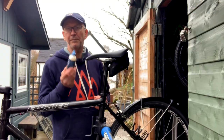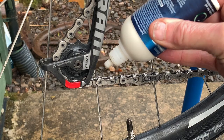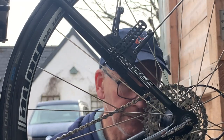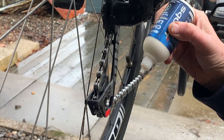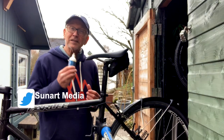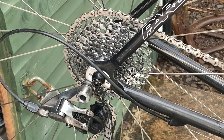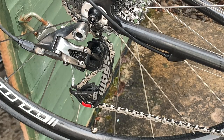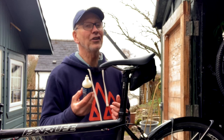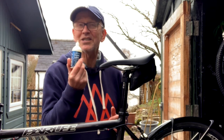The lube is wax in a water-based emulsion. Once you have stripped the chain of any lube, you can apply this stuff — it's meant to be cleaner and extend your chain life. When applying it, I find it's easy to waste quite a lot. It is thin and it drips, and I have gone through loads. This is the cold weather version, so it's perhaps thinner than the regular one, but it's only a few degrees above freezing right now, and I went through the regular one just as fast. In fact, it's probably too thin for the wet winter conditions we get. Many times I would get home from a long ride with nothing left on the chain, which is great that it didn't pick up dirt — but before heading indoors, I had to immediately clean and put another load on my chain again. It didn't seem to give the lasting protection for Scottish winter conditions that I wanted.